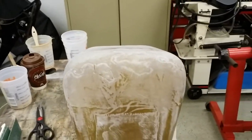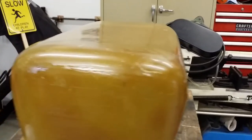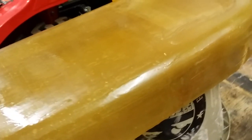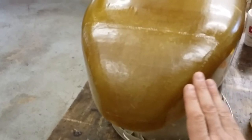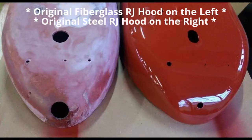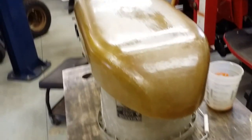Still working on it. Doing a lot of shaping right now to try to get this hood shaped the way I want it — nice and round. One thing that's interesting about the original fiberglass hoods is the backs come to a real kind of point, compared to being flat like a steel hood. So I'm building it up at this point to try to get that point. You can see that it's laying out pretty nice. So it continues — more sanding, more shaping, loads of fun.